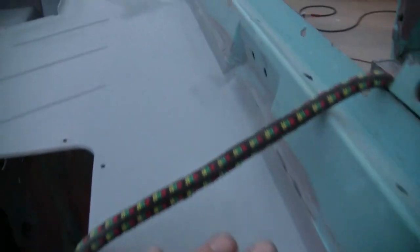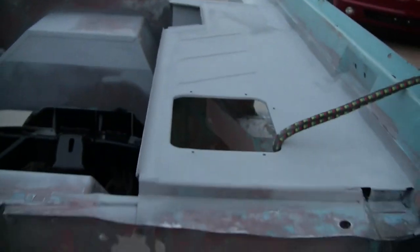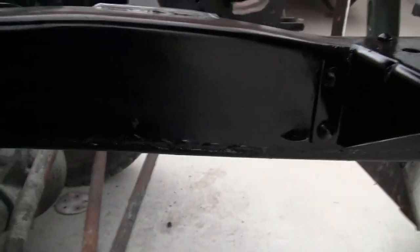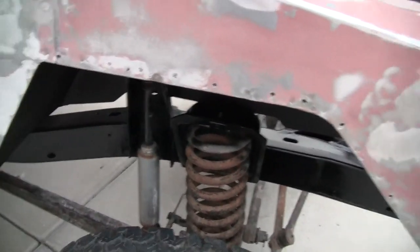This will be sanded down to metal for the most part when we get ready to paint. We painted the back side of the shock tower, the back side of the spring coil retainer, and then we put the Dupli-Color surface on the underneath side. It was all black anyway from the original owner with his brushed-on underlayment, and I wasn't going to strip all that off.